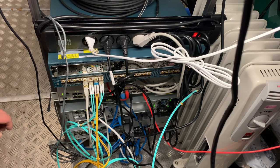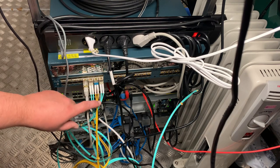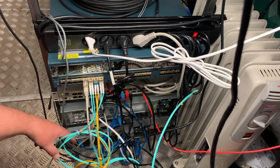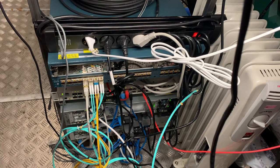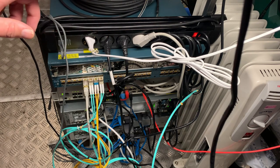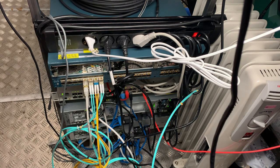Anyway, now my next task is to move the single mode module from the Windows server to the Unix or the Linux server and see if that activates. Because then I've confirmed that I can interconnect the long distance cable and then the servers with single mode. And then I'll just have to bite the bullet and buy more single mode modules that seem to work.